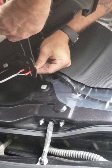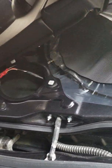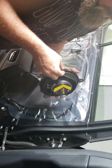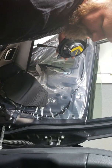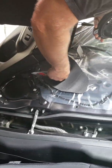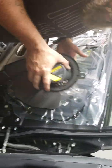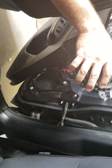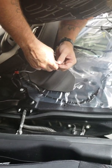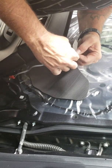The only difference on the front versus the back for the wiring: on the back side of the plastic, somewhere in there you want to break a little of the tab off, because the wire doesn't feed behind the speaker in the front doors the way it does in the rear. You want somewhere to let that wire lay behind the speaker without getting flattened. On this particular one, fortunately it feeds through the door so we can just leave it as is.